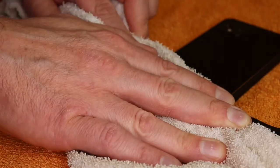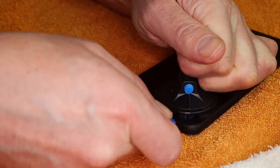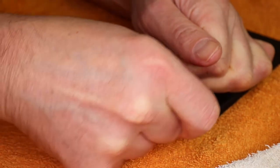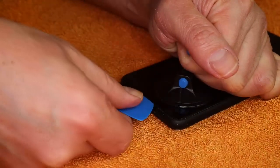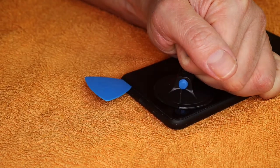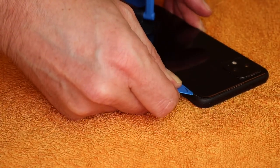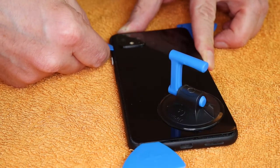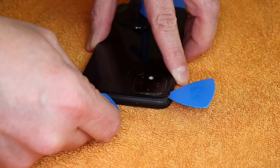Let's start opening. I put the eye opener onto the back of the device and press it on for several minutes. Then I use the suction cup and pull, but not too much. I use the pick to open a gap between back and frame of the case. The first attempt fails — the adhesive is still too strong. Some more heating, and all in all we are now at 10 minutes and finally I manage to shift the pick into the phone case. I push it to both ends of the shorter edge and cut through the adhesive. A second pick prevents the adhesive from reconnecting. I use further picks for the other edges. Fortunately, a set consists always of 6 of them. Unlike the internet says, I can cut through the rest without any more heating. But I do need to take care not to cut too deep into the device with all its tiny parts.